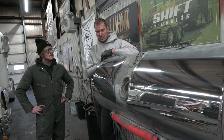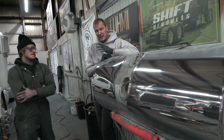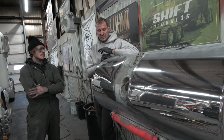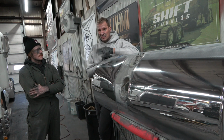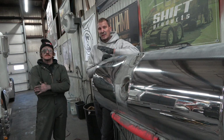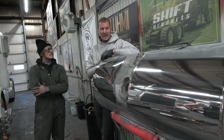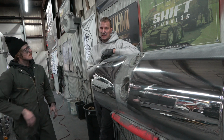He caught on to it really super fast, paid attention. Everything I've thrown at you so far, you've done and excelled. You're starting to see when your rouge is drying out and all that stuff. But honestly, this is the steps. And everybody still keeps asking me for the perfect grit to sand with. I'm gonna have to put on another sanding video. Honestly, your first grit gets it smooth. Every grit after makes it polishable.